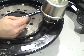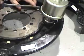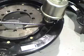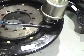So if you can't get the adjusters turned back through the inspection ports because they're seized, we can always take off the air line, take off the air chamber, pull out the wedge, and usually the brake shoes will come back enough that you can get the drum off.